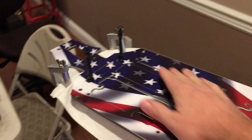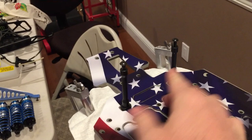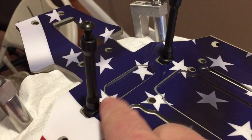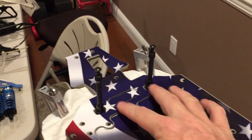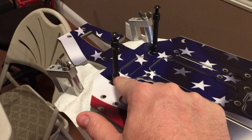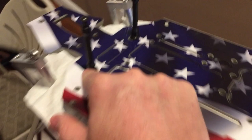But before I do that, this has been sitting already for 2 days. I did heat it up once more. I put these rods here, these shafts here, that is where your steering bearings roll on. They roll here and here. This is where your steering assembly mounts to, gets installed to. And always remember to throw a little coating of grease here. Because a lot of times if you're washing or driving in moisture, sometimes the bearings get stuck to this. So always give a little thin coat of grease here.